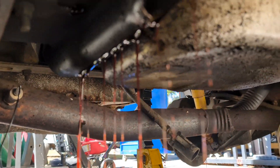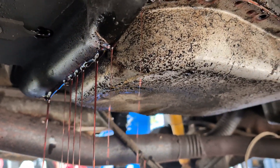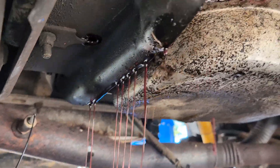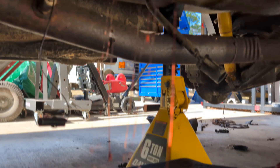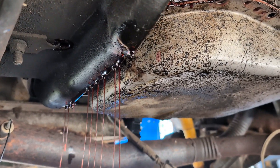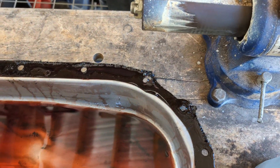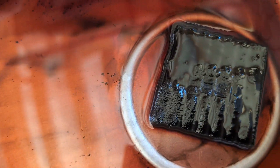I've finally got enough of the rear bolts loose that it's starting to come down. I've got a pan in position in the back. Trying to avoid as much mess as I can. The fluid is a dark red, so it's got some use on it, but I'm not seeing anything particularly scary. Looking at the fluid closely — it is dark, there is particulate in here. And this is our magnet and it appears to be quite covered. So this fluid definitely had some age on it and it did need to be changed.